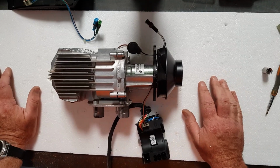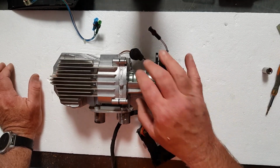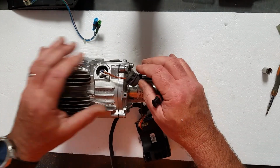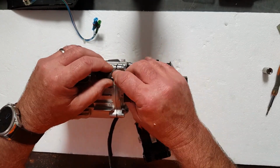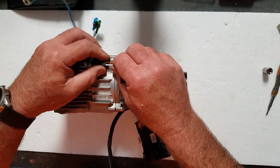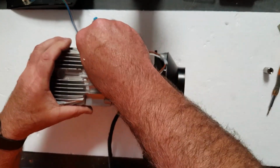If you're getting smoke coming out of the heater during the startup process, then chances are it's going to be your glow plug screen, and it's a very easy fix. Take it out, clean it, or replace it. In situ, in the van, you don't have to pull the heater apart to do that, and put it all back together, and it should stop the smoking.